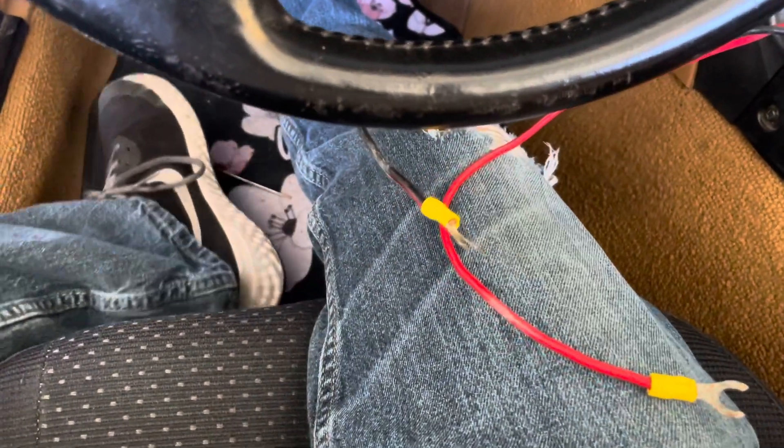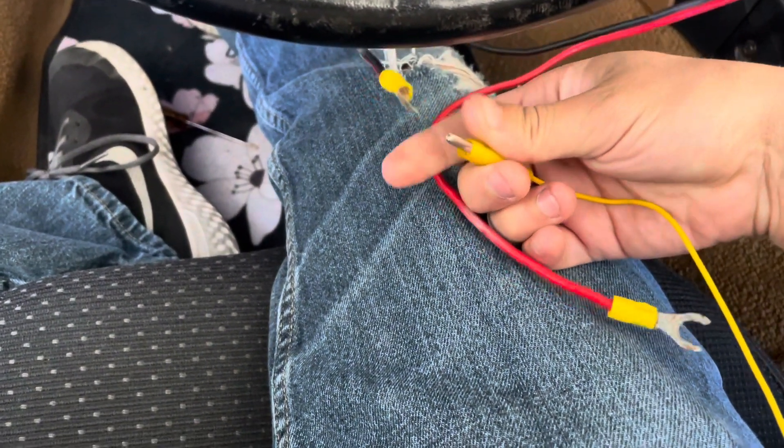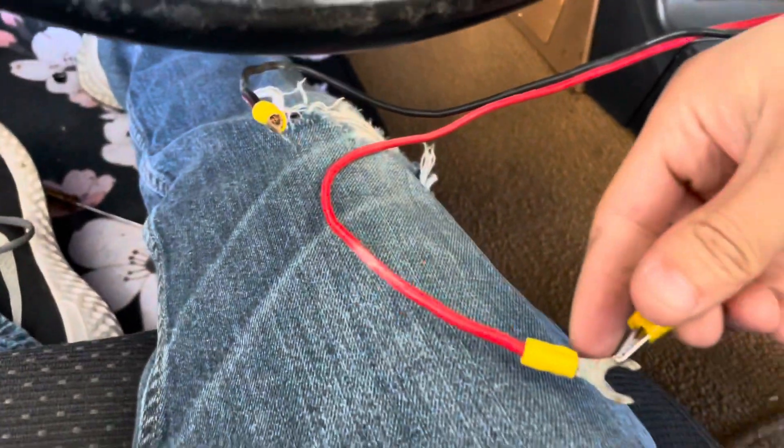What you want to do is put down firm brake pressure and just turn the solenoid on and off — you should feel the brake pedal sinking. Once it's all the way down, go ahead and actuate the pump and you'll feel the pedal pump back up.